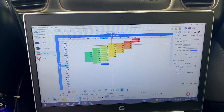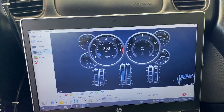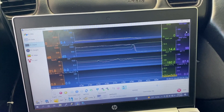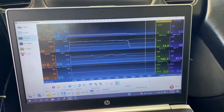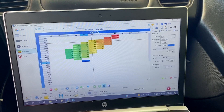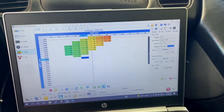Alright, so we're at the gas station now, about two hours later. Took a crash course learning our way through EFI Live and it is pretty intricate — HP Tuners is a lot more dumbed down and straightforward. But we have our charts set up and did a quick data log. We're monitoring RPM, throttle position, vehicle speed, O2 millivolts, MAP data, spark knock, and torque — pretty much everything we need. With his car we're switching it from 93 to E85, and once he comes out we'll be siphoning out the 93, adding the E, then I'll take out a little timing and multiply his VE tables starting at about 20 percent to accommodate.